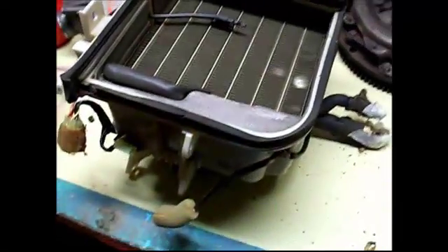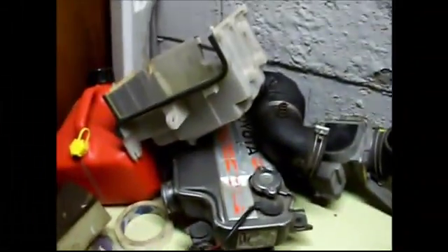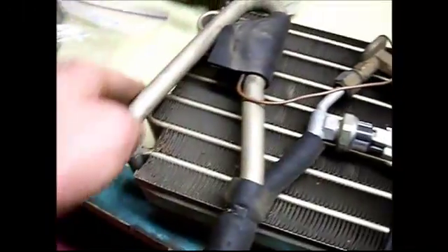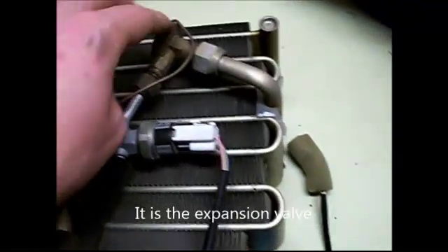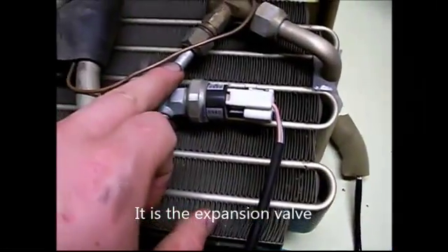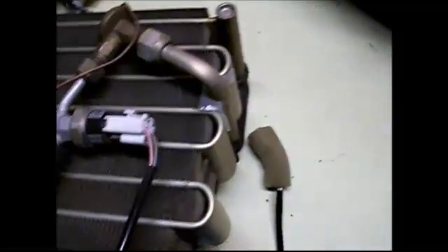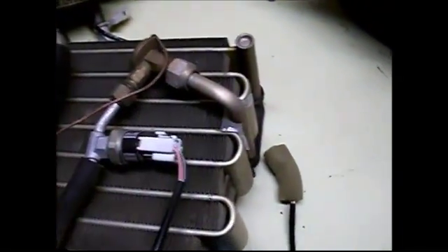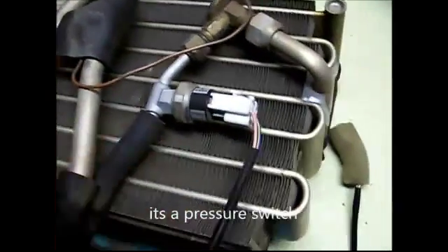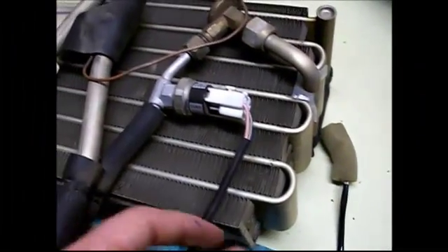So we're going to take apart this and see what's inside. We took apart the unit — this is just the plastic casing that houses the evaporator. Taking a look at this, this is the back side of it. This is the return line, it comes up and out, and this is the input line. My best guess is this is the expansion valve — you can see the input tube is smaller than the output, so this expansion valve expands the refrigerant to a larger diameter, probably at a fixed flow rate. There's also some sensor in here — maybe for flow rate or temperature, I'm not sure.